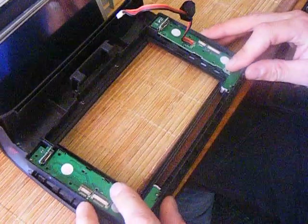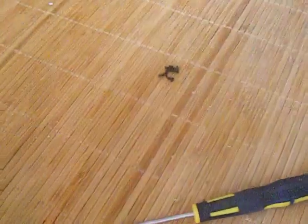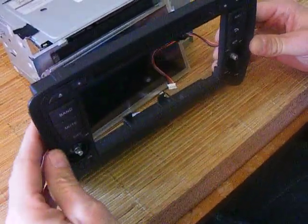These panels here — your control panels — all the screws I've taken out here I've left on the left-hand side, so I know they're for there. On the ones for the right, I've left on the right-hand side, so I know they're for there. Hold the fascia up, squeeze the button, and pull it gently and it'll come off. Same again — left on left, right on right.